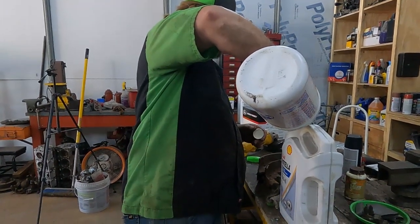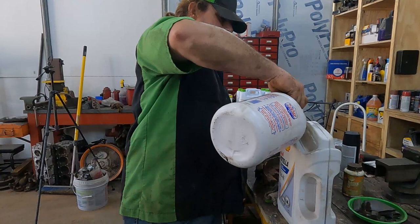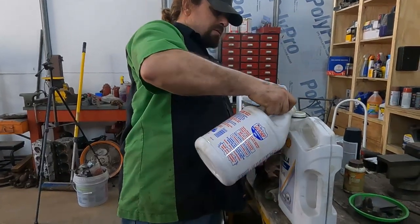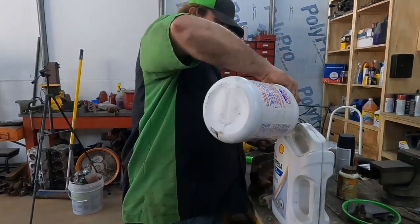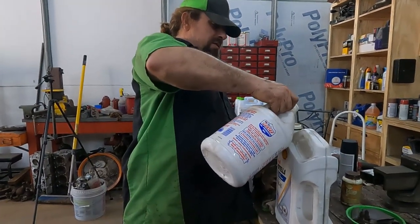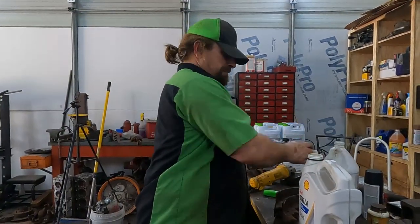And I do it this way because Lucas takes forever to pour. And it's cheaper to buy it in the gallon. Where do you buy it in the gallon? I think I've only seen the squeeze bottles. Walmart is where we buy it in the gallon. And then you just add enough to replace a quart during your oil change. If you have an old car like this one, it only takes 5 quarts to change it. Which, this is a newer motor, it may take 6, but we'll see. One gallon, and a quart makes an oil change.